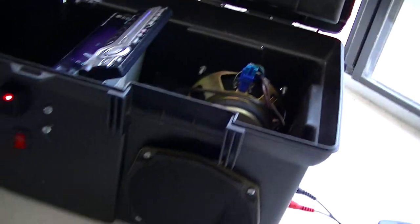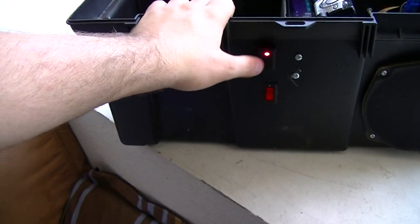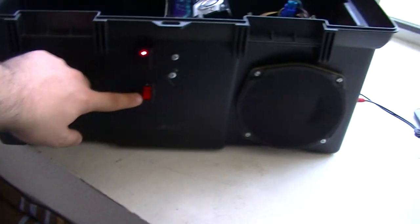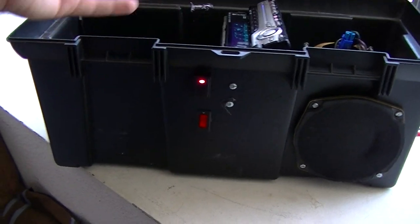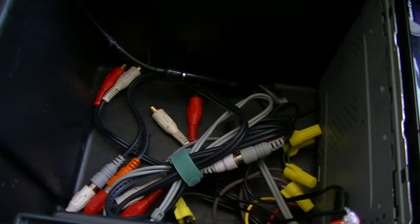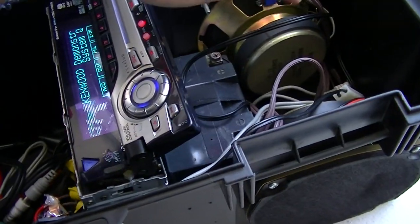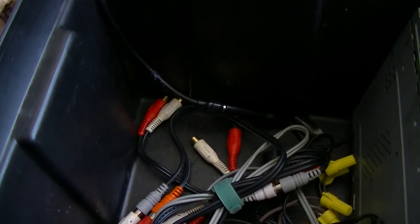I had the charger for the motorcycle battery downstairs. This one here is the main power switch — it completely disconnects the battery from the head unit, which will wipe away all of the settings, which is why it's primarily left on. This one here is the ignition switch; it provides power to the head unit in a way that tells it to wake up like the car is starting. I've also made an Android app and gotten a Bluetooth module for my Arduino, so I'll be able to control the lights wirelessly. There will also be a car USB adapter, which will basically convert the 12V current from the battery into usable USB voltage for the Arduino, and I'll probably run a wire over to the front of my bike to keep my phone charged.